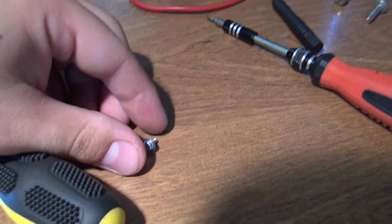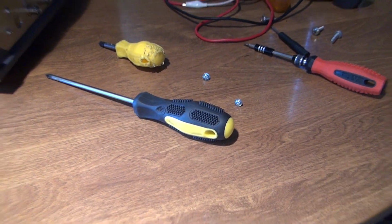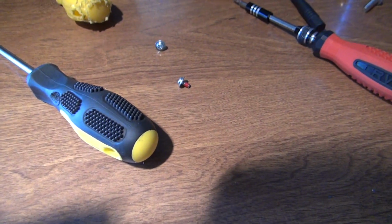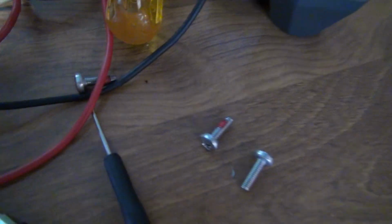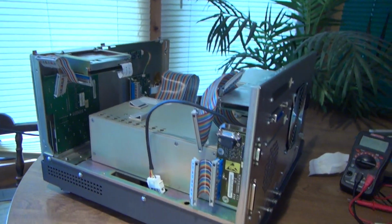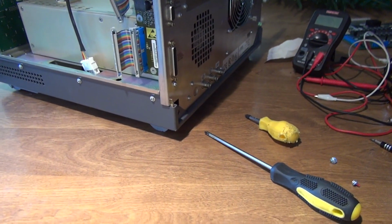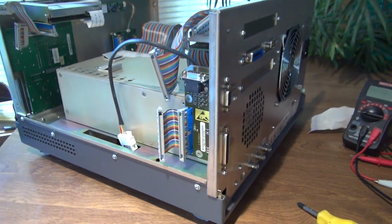They are putting red Loctite on the threads. That's the permanent strength thread Loctite. You would put blue on something that has the possibility of wiggling out from vibrations and may need service later, but they are putting red Loctite on everything in here. So it does require a pretty substantial force to break free. I don't know what the specific foot-pounds of it are.